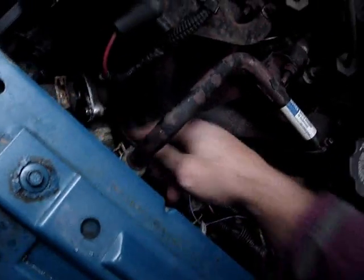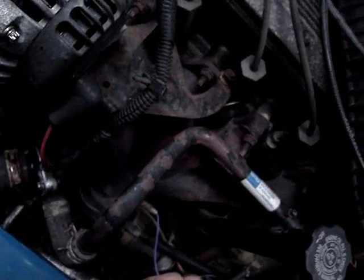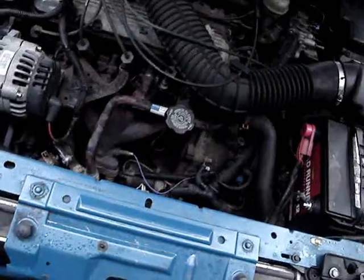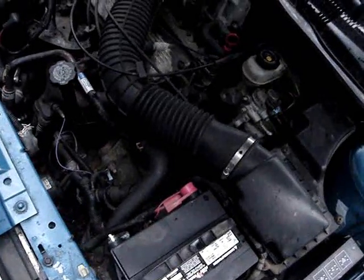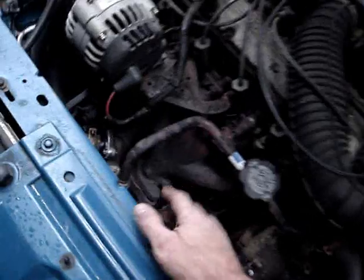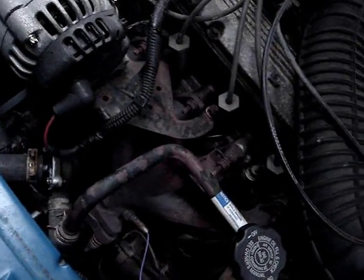I had to heat these a little bit to get the bolts out, and I went to the local car parts distributor and found some metric bolts that fit in there. Not quite the original equipment stuff. We could have gone to a dealership, they said, if I wanted something identical original, but these worked. They were in there so tight, a little bit of aluminum came off. I believe that's an aluminum casting. A little bit of aluminum was in the threads, and I seen them. I'm not putting that stuff back in there. But anyway,